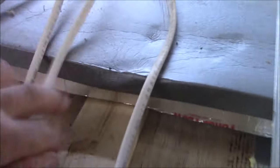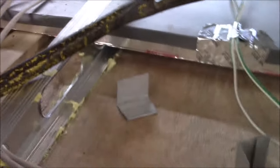Oh, okay. So what we generally look for, though, is like these wires keep coming, they come across. Here's one right here. And they start digging, and this is a good example. You got one here. And it'll start digging in, and then eventually, this is just foam. And then when it creates a hole, now you have air coming up into this, if you want to call this the attic area. That's not a good mix on a hot roof. There's another one right there. So we got to fix that. And these are things that we look for.